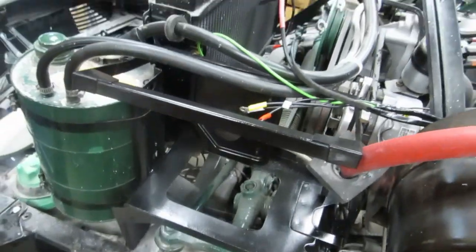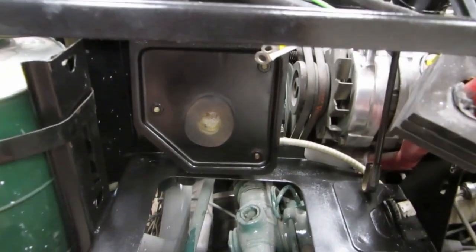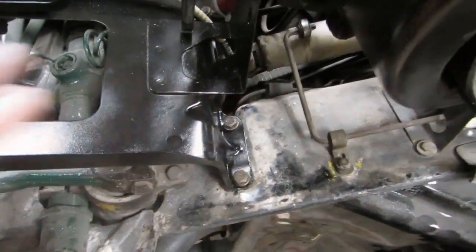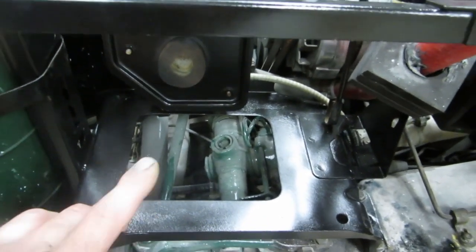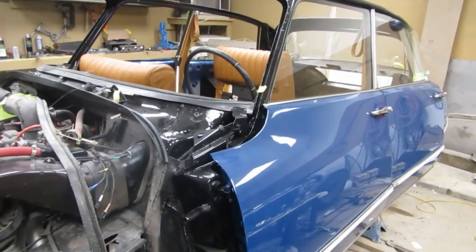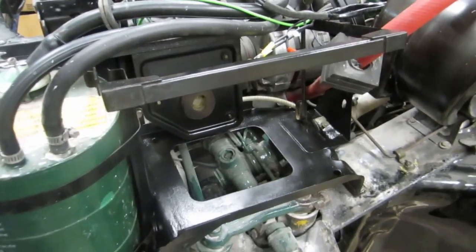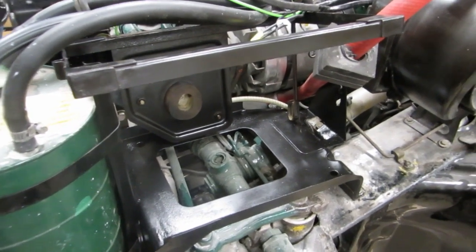This all saved from the couple hundred dollar parts car we bought a couple weeks ago, so that is awesome. That thing has been so handy already. This battery tray was in absolutely beautiful condition, and because they were available on either side, there was no homemade anything. That's all into the original holes in the chassis. Most of the cars I've seen have the battery on this side. This was a European export car, so a few differences that were not really that critical, but we could not leave the battery there and hook up the air conditioning, so that is why we relocated it back over here, which I think is the conventional location on any North American model I've seen.